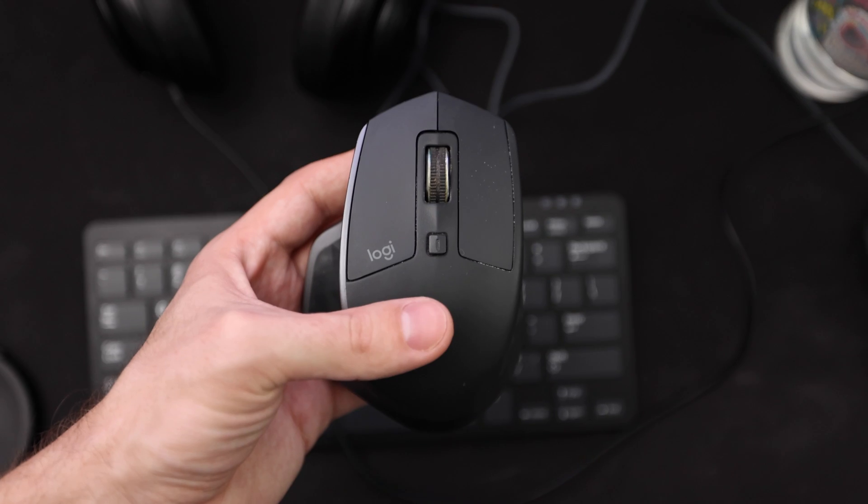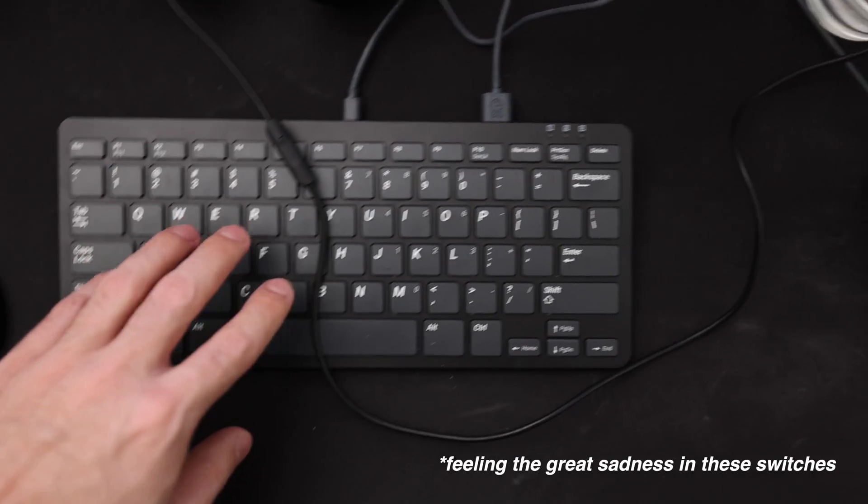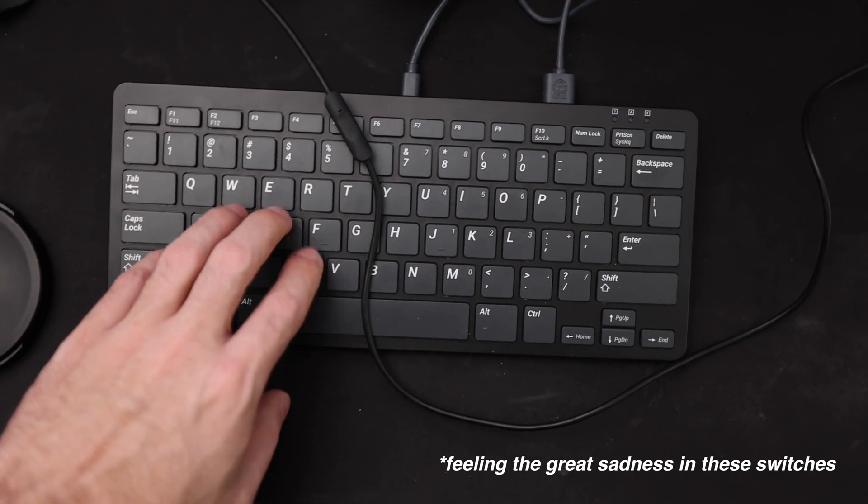I should note I started with a wired keyboard but no wired mouse — I was trying to use my wireless MX Master 2S. That worked for a little bit, but it suddenly stopped working and I couldn't figure out how to get it going again. That actually partly delayed this video. I ended up ordering a wired keyboard and mouse from the Raspberry Pi Foundation and that all worked fine. So something to note right off the bat: if you use wireless devices you may need to do some extra troubleshooting and configuration.